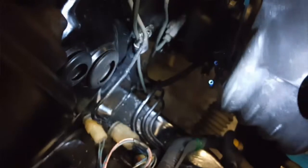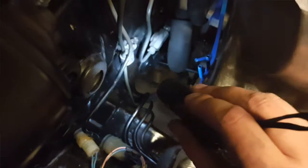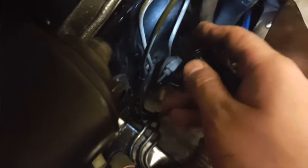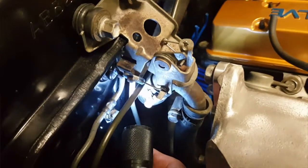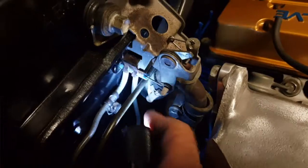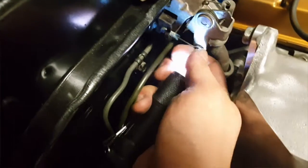Anyways we'll go up. There's our line right here. It comes up — I was able to utilize this factory clip right here. It comes up behind the brake line and then goes in front, routing through between the heater valve and line and the firewall, so it goes through just like the brake lines do. It's important that this line is not touching anything — that it won't be touching anything when this valve activates.